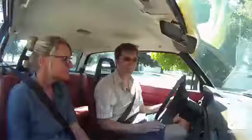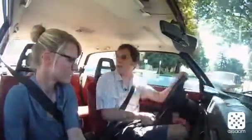That's a 40-mile range. So Michael, show us how it works. You turn the key to actuate one of the contactors, and you hear that little putter-putter sound — that's the electric vacuum pump that runs the power brakes. So it's ready to go. The car has a stick shift but no clutch — it's a little tricky. You hear that whine because the controller is a 2.5 kilohertz pulse-width modulation. Until you get more than 10% of the throttle, then it goes silent.